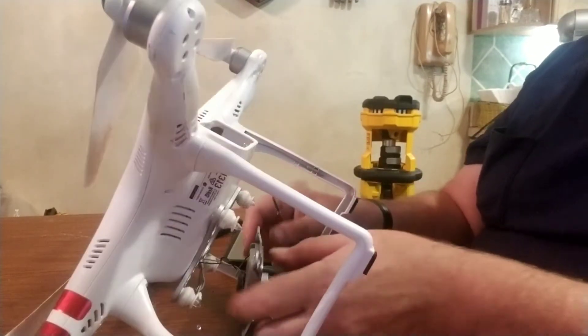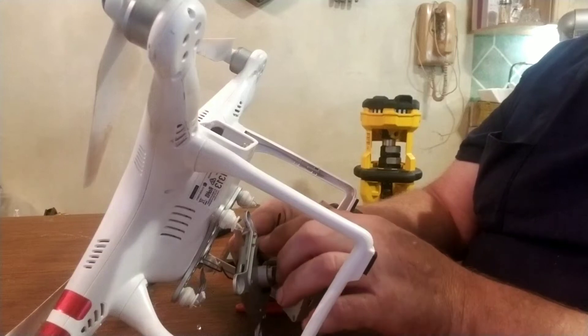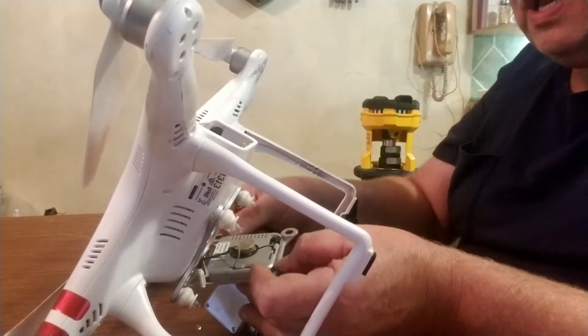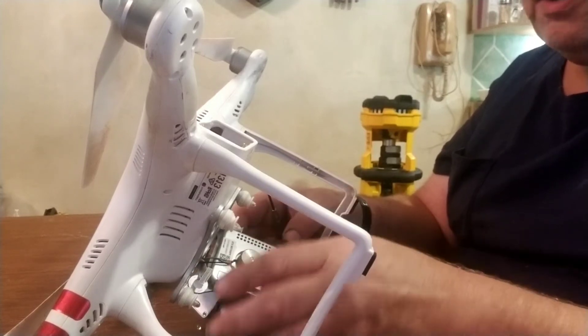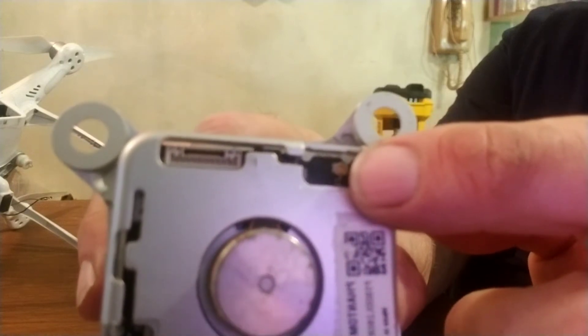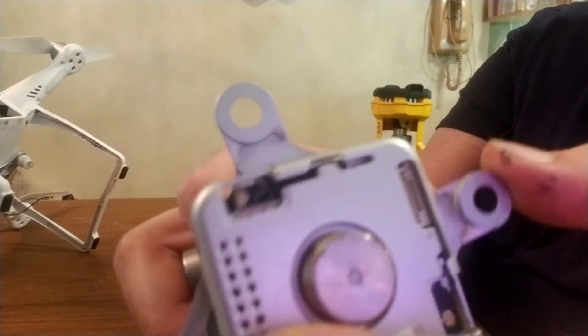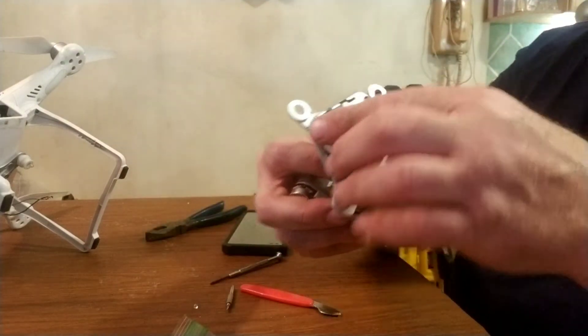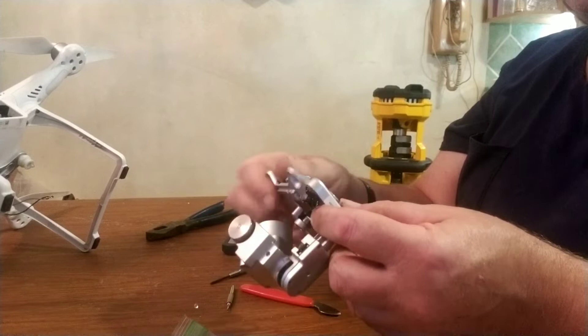Most of the other videos don't show you this, but I'm going to show you. In order to get these two wires off that are still here, you need to flip it over and remove the two Phillips screws that are underneath each of the little hatch covers. The only way to get that hatch cover off is to remove those screws, and once that's off we can remove the little wire connector down here on the circuit board. The gray one goes here under the cover next to the ribbon cable, and the black one goes furthest away from the ribbon cable. Those round terminals were both snap connections — just press fit. You reach underneath with a little pick tool and pull straight up and they pop right off.